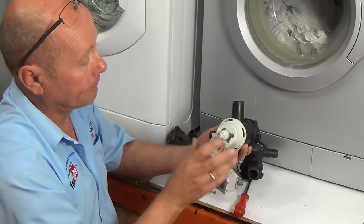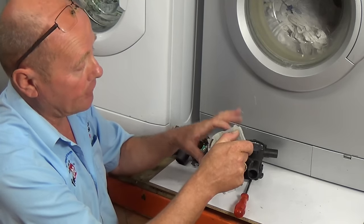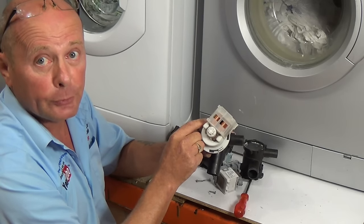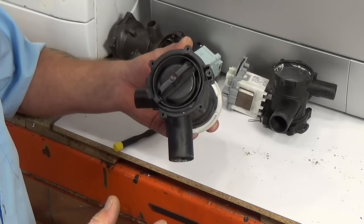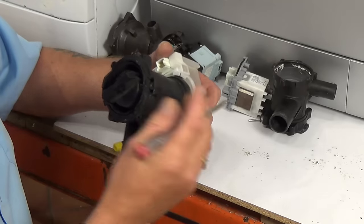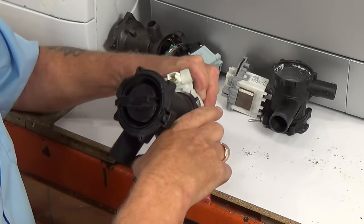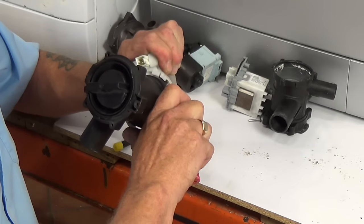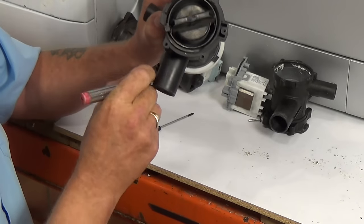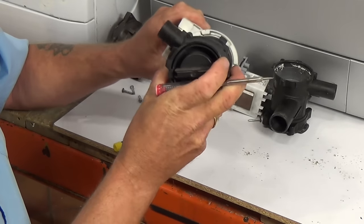On the third type, which is a push-tab system, there are no screws. If you look closely all the way around — and I'll zoom in on this — there is a tab you need to press down before twisting the motor off. On the twist-fit pump system there are usually one or two tabs that need to be pressed while you twist the pump. It is quite tricky to do with one hand — there is one on this side and another one on this side. Once you've pressed both down you are able to twist the pump open.